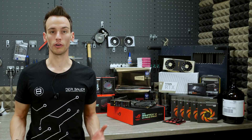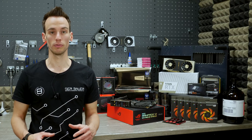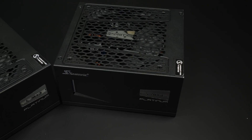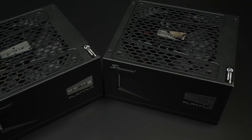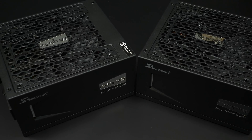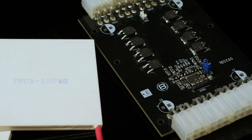The condensating process will be crucial in this system and the power consumption will be extremely high because we will be using some high-performance and high-power-consumption TEC elements. For this we will have two PSUs from Seasonic with 1300W each — one PSU powering the whole system including the Titan RTX, mainboard, and CPU, and then a separate PSU just for the cooling system and the TEC elements.